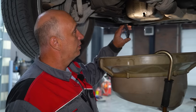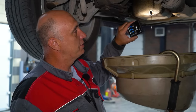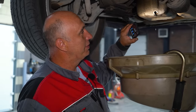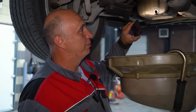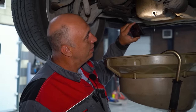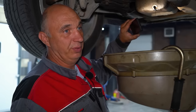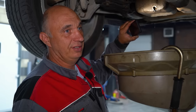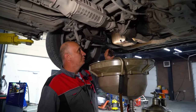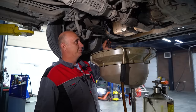Okay, so we just dropped the oil, and from the looks of it, the quality of this oil — going off of how it looks — I reckon we'd better flush the engine prior to pouring in the additives, because this is just... yeah, this looks pretty bad. More like tar than motor oil. So you bought it, changed the oil, and have been topping it off ever since? The point is we'd better flush the engine because this just looks horrible. I'm afraid it won't make it far on the additives.